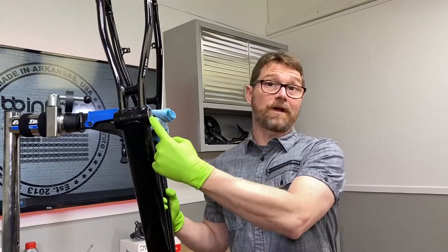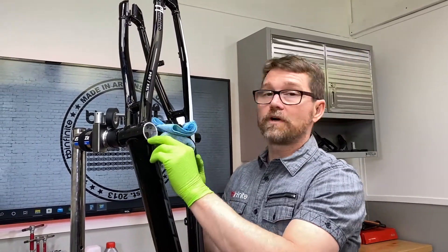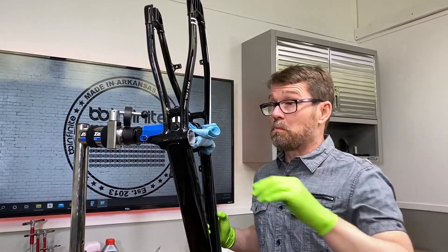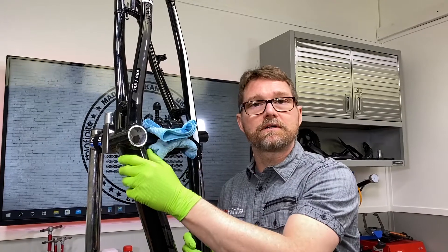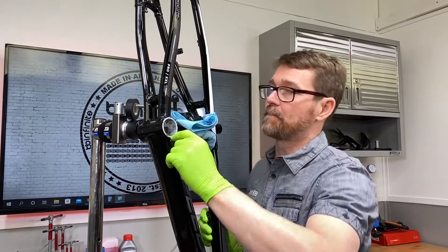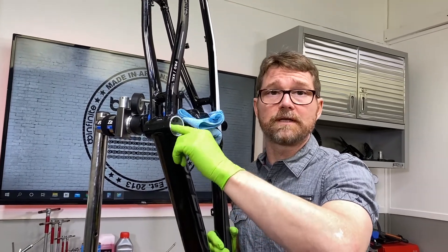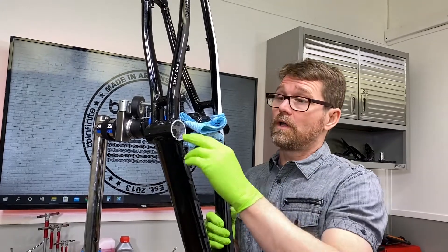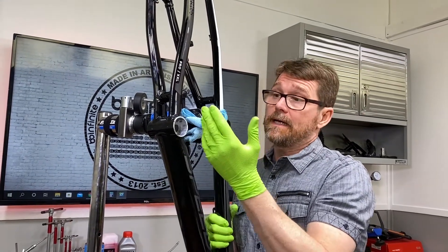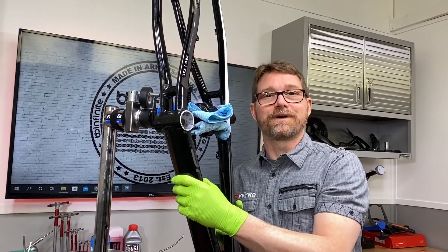The hole is not round - that's mainly the problem. This is very typical of bikes that are welded together. Even though this cylinder was turned on a CNC machine very accurately, when you come back and start welding elements to it, it creates stress risers and starts to egg out portions of the bore. There's no slag or high spots, no welded material that should have been cleaned out - this is just a dimensional issue where the hole is oblong due to welding stresses during construction. Ideally it would have been reamed afterward.